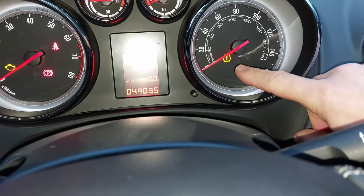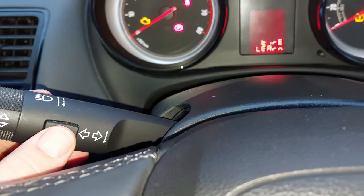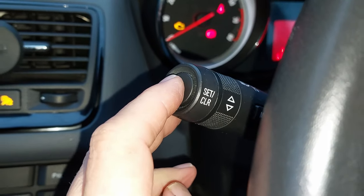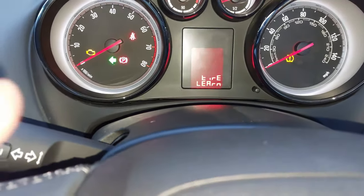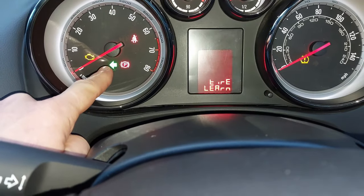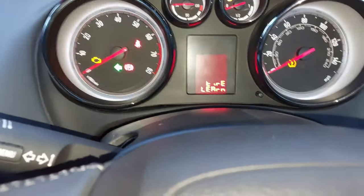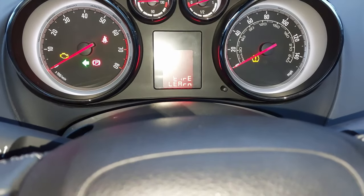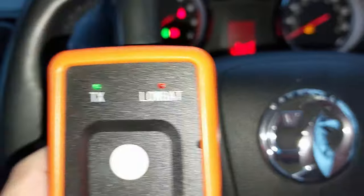You can see the tire pressure sensor light is flashing. If I press menu it's got 'tire learn' up on the dashboard. At the end here where it says set and clear — hold that down — and there, it's beeped. It's telling me to do the front left tire first, then the front driver's side, then the driver's rear, then the passenger's rear. Every time it works you get a honk on the horn.